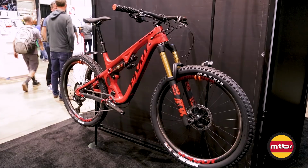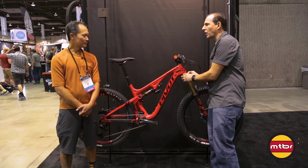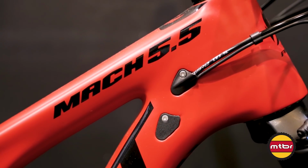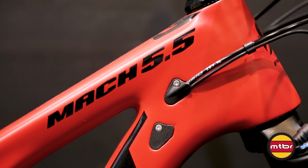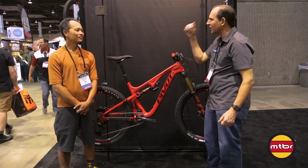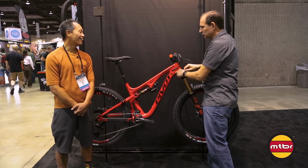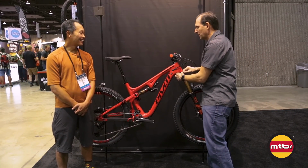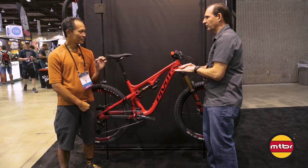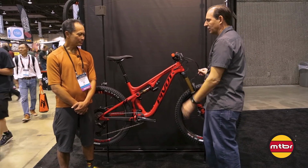And then even things like the wiring of the system. The original things we tested were hardwired into the fork, and I was riding a sample and slid out in a corner. Just a minor slide out, but the handlebar spun around, and I got up and there were wires hanging out of the top. It just stripped everything out of there, and so now it's just a quick release. It just pops out. This swivels around if the handlebars twist around. Just a lot of things to where the whole system is very user-friendly, refined, and dialed in every way.